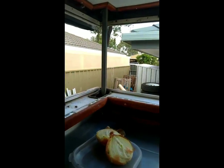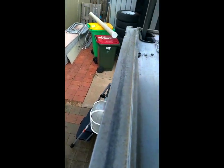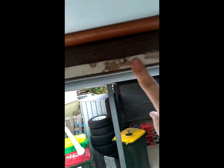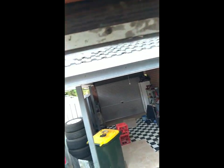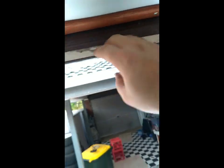We've got the old skirt off. We just ended up pulling it out of the track along here — we didn't need to lubricate or anything. What we're going to do now is just do a basic clean up. As you see along here it's all filthy — mould, cobwebs — so I'm going to clean it all up, clean the track up. I'll probably use a wire brush inside the track and at the top here.